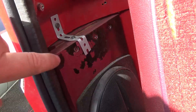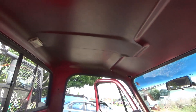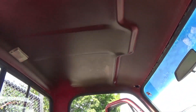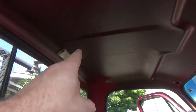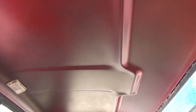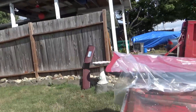My cheesy paint job is coming off my speaker holders there, but oh well. I should mention that if you had a headliner in that you were replacing, it would still be held in by the sun visors and by the dome light, so you'd have to pull those out to get the whole headliner to drop. But it's not glued at all to the roof — it just drops right down. It's on a hard backing.